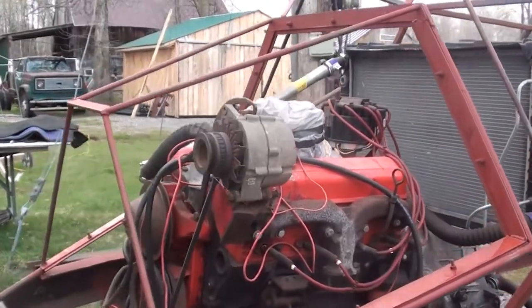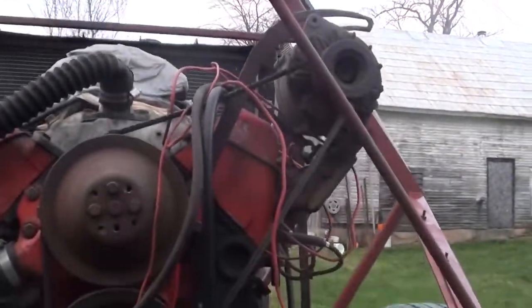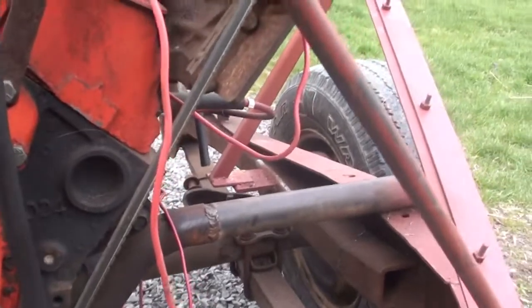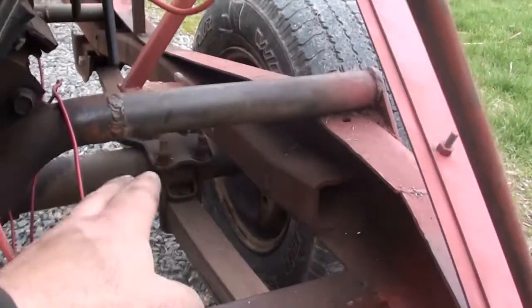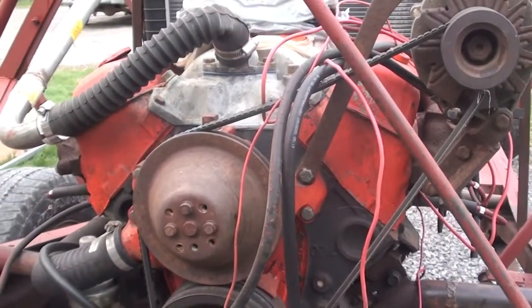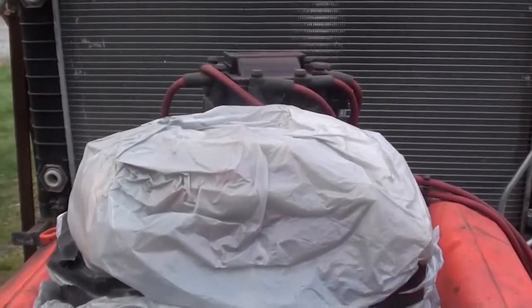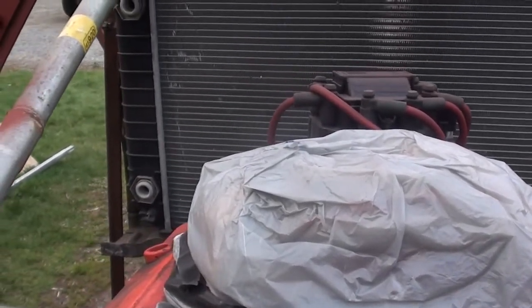Now you can start to see what we were talking about with the alternator - it is just a little bit too high up and out to the side. We're hoping we can move it down into this space here, basically just drop it down and build a bracket to remount it - we'll probably use a smaller belt. Other than that there's plenty of clearance over the carburetor to get an air intake or air breather filter - we'll have no problems rigging something up there.